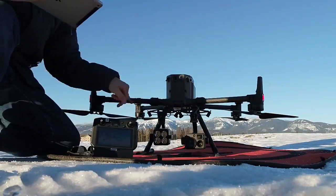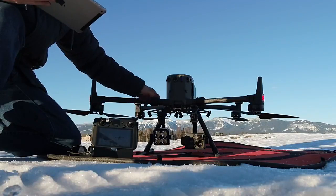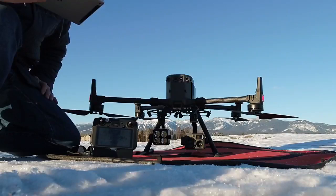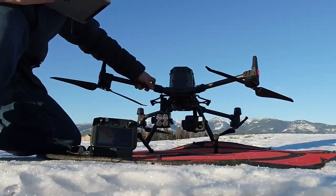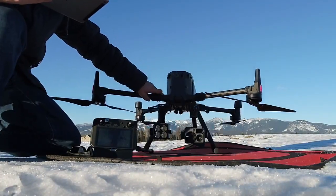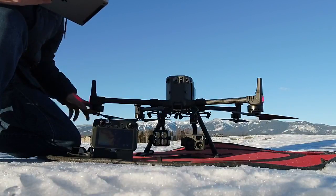The 300 is going to come with a single-mount camera, but you could add this dual-mount on, and it's super easy to install — four bolts and a plug. If you guys remember back in the M210 days, if you ever wanted to go from dual camera to single on that, it was torture. Little skinny ribbon cable, really challenging to swap those over. Nowadays, really easy — two little plugs in the bottom. Swap over to a dual payload if you want it. And if you're only flying with one camera, you could calibrate the center of gravity once you're up in the air. Pretty slick setup from DJI.